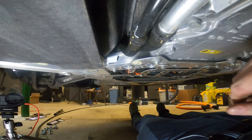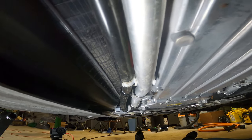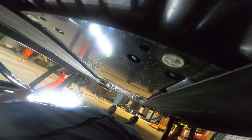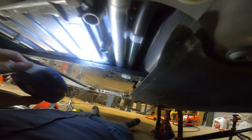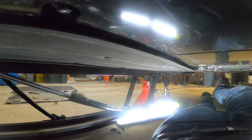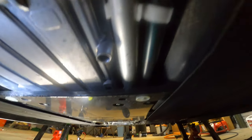Moving from the front of the car back, here is our battery pack with coolant lines on each side — one hot, one cold. One side takes the heat back from the engine in the rear and sends cool water back to it. There's also a cross member here that goes underneath the battery with sound deadening material on each side. Shining a light in there, you can see how we would get the cross member off if we needed to remove it to take the battery out. Very interesting.